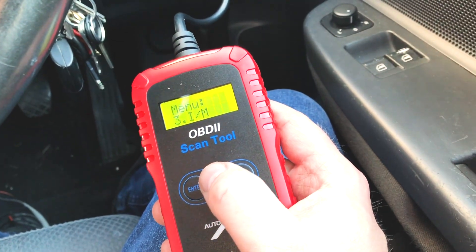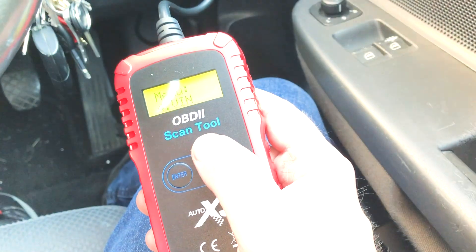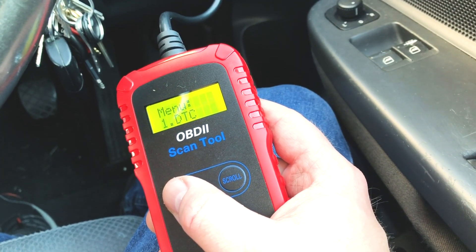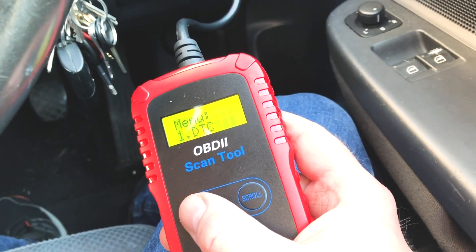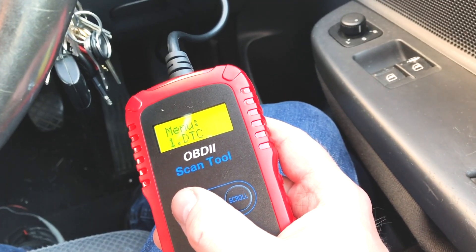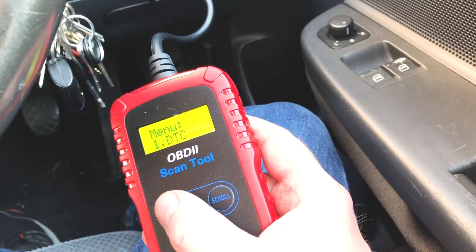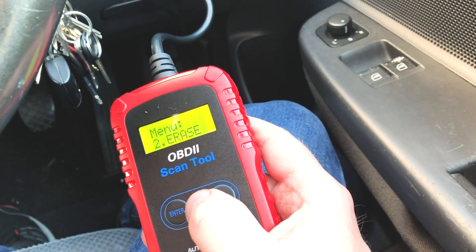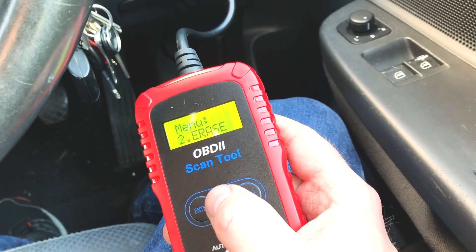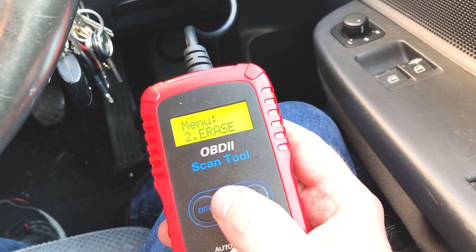Then you press enter to go to the main menu. You can view the car's VIN number, which I won't do here just for security reasons. What I'm going to do is tap on the diagnostic trouble codes option — diagnosing any trouble codes that the engine may have or the ECU has acknowledged. Luckily my car doesn't have any codes, so I can't show you any problem codes. You can also select option two to erase them. There is a warning in the manual saying it will erase all codes, including any manufacturer codes that may be available for recalls and such.